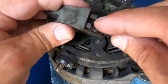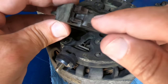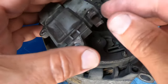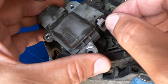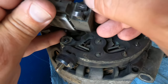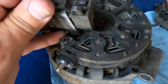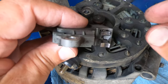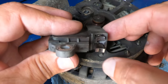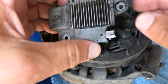You can see how one's way longer than the other. This one here is really, really worn. I don't know if a piece of debris might have got in between that and really started wearing on it. You can see how short that particular brush is — it's got a groove bored into it pretty good. This one here is in pretty decent shape still. Not bad for 266,000 miles, for as much brush as still is there.